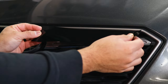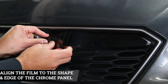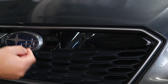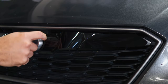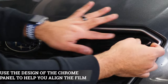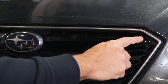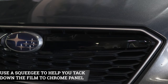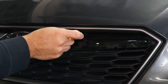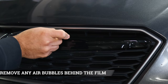We're going to start with the piece that covers the first section of the panel. All we need to do is align it on this section — make sure you align it and just cover the chrome. Once it's aligned, give yourself a little bit more material to make sure you cover the chrome on the edge. Then lift the film and follow the design, using the top half as the guide to align the rest of the film. Once you place the film, grab your squeegee and start securing the entire panel — tack it down slowly at an angle to remove all of the air trapped underneath the film.